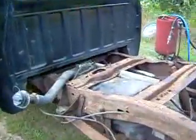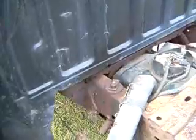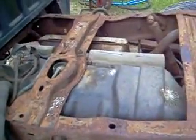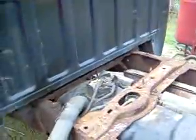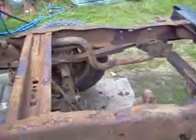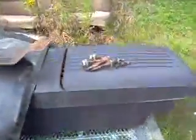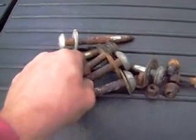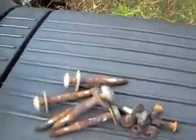I had a little bit of a struggle with one of the bolts. The only one that was a main problem was this front one right here, right behind the driver's door. That bolt was a little tough — gas tank's right there, so we're talking 15 years of dust, dirt, rust. But the rest of them all came out easy. There are six bolts that hold the box on, held on with torque bolts, and the clips are actually part of the frame. Pretty simple. Five of them came out really, really simple — no problem. Just had to spray a little WD-40 on them.